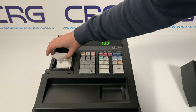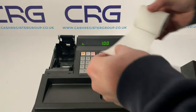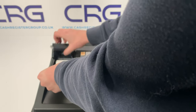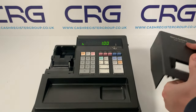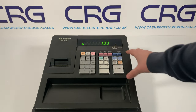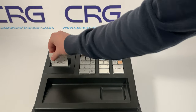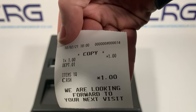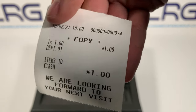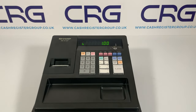If I lift up the platen arm, you'll see the paper is coming from the top — the till roll should always be loaded that way so the thermal side is on the outside. Clamping that back down, putting the cover back on, and using the reprint button — it's now printing out correctly. The receipt does say 'copy' because the machine was trying to print the original onto the back side where it won't show.